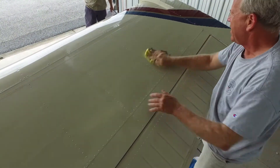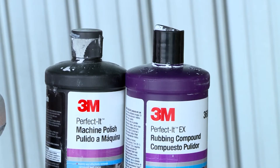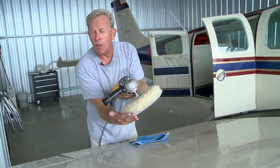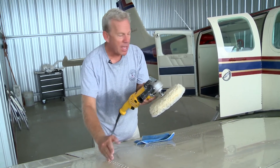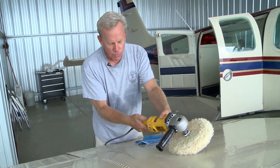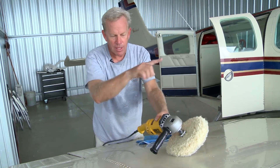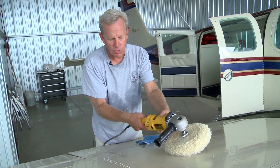Adrian has a technique he regularly uses to bring the shine back to older airplanes. To start, you'll need an orbital buffer with a wool pad and some 3M Perfect Finish compound. Set the material on the surface, then generally turn it up on about a 30 to 45 degree angle, so you're using only really a portion of the pad. You've got to think of the direction that it's turning and keep that away from edges and sharp areas so it doesn't grip and get ripped out of your hands. In this case, we're running at about 1,800 RPMs, going back and forth in one direction and then 90 degrees to that in the other. Because the pad is turning, that'll help remove some of the scratches and the swirls. Just start gently.